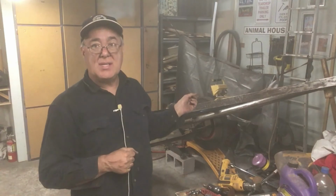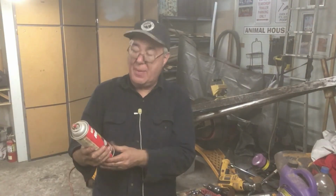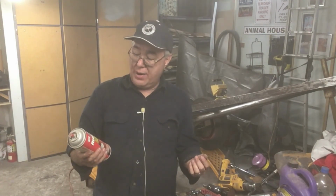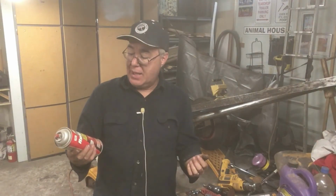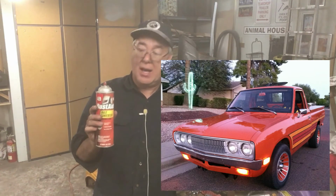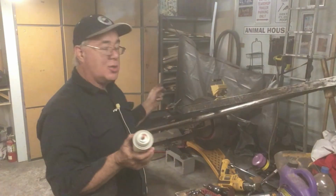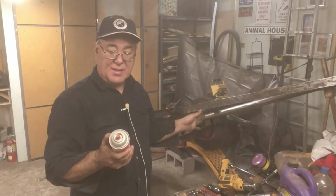And then I think we're going to put some primer on here. It's called Rust-Aid. After cleaning the frame as good as I can, I'm going to spray this on it. And what it is, is a rust converter where it converts the rust into a black primer. It's sandable, it's paintable. I used it on my Datsun 620 project and it turned out awesome. So it's a little expensive, but I want to make sure we have a nice coat of primer on this trailer that converts the rust,